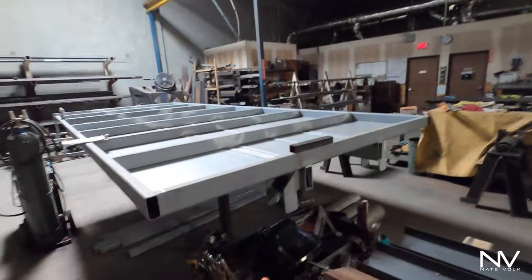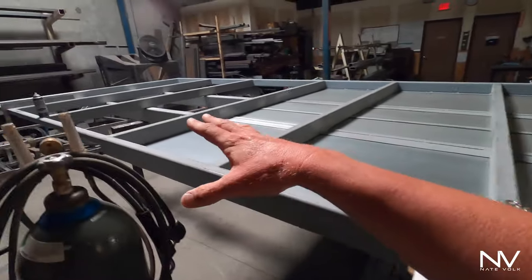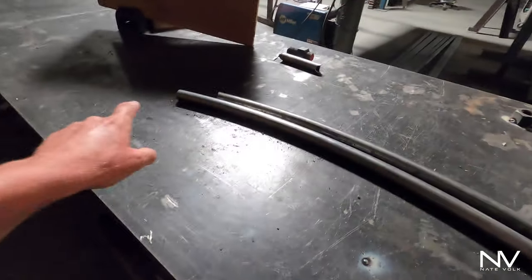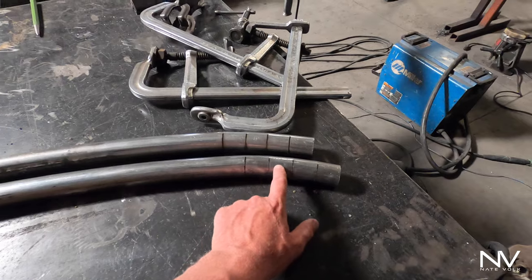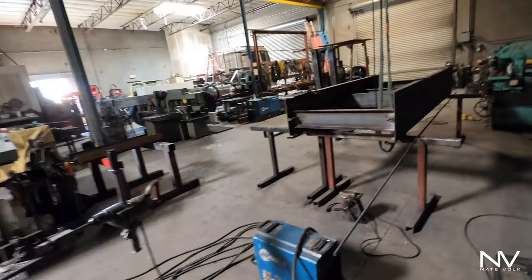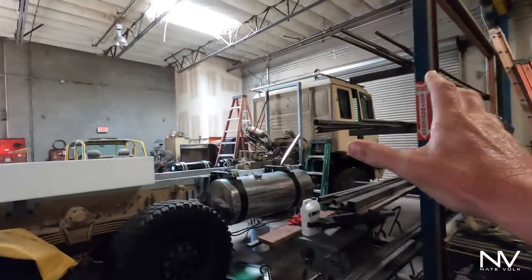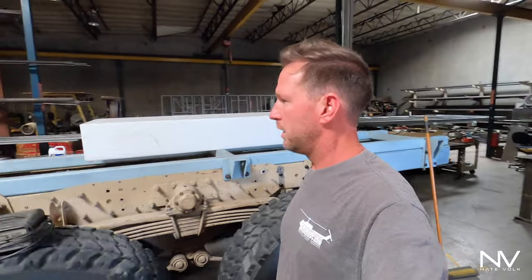Here's the base with the floor — we welded in this sheet on the bottom and we'll fill it all with insulation, and all the plumbing, electrical, and everything will live in there. These bars we finally got bent right to how I wanted them to look for the front — kind of the brush bars in front of the windshield — with a nice radius. The bender won't roll the first six inches so we ended up cutting and slicing some slots and then bending each part individually to give a nice curve that kicks into that elbow up top. It worked out really nicely — it follows the roofline and the look and feel of the whole truck, so I think it'll blend really well.